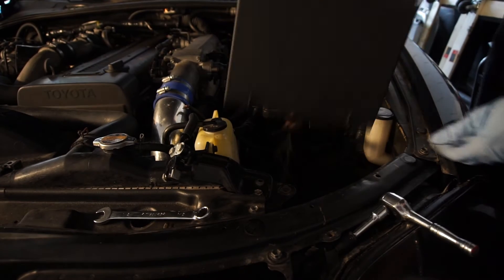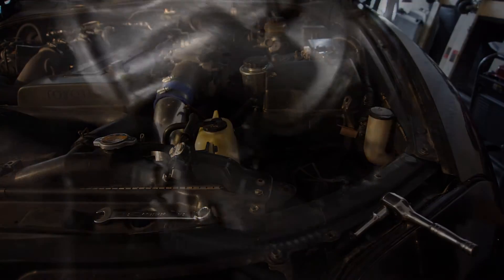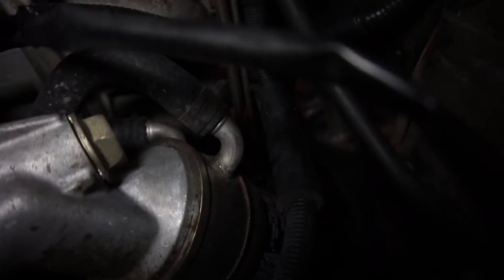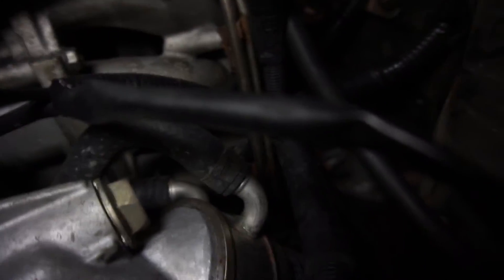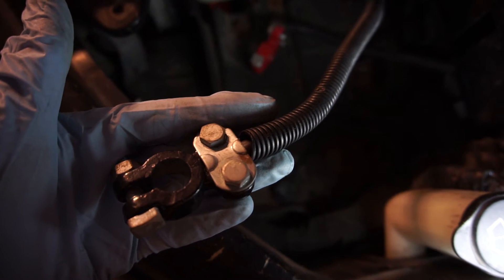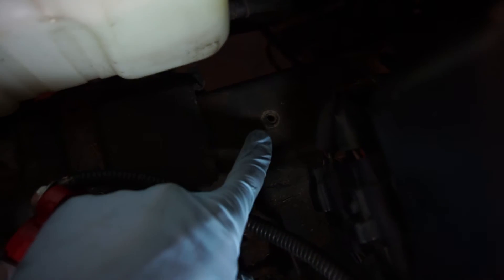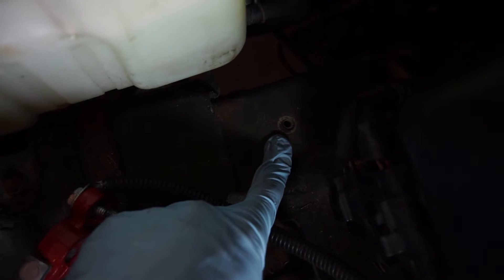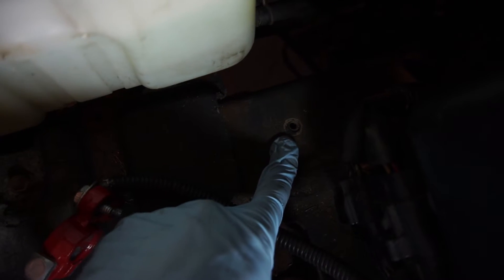To make room I'm going to disconnect and remove the battery. The engine block ground can be found underneath the oil filter, and this can be traced all the way to the negative battery terminal. I'm going to be using this location to ground since I'm going to relocate my battery to the trunk, so the engine block will be grounded to the frame.